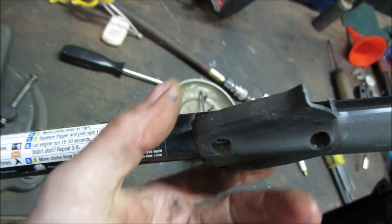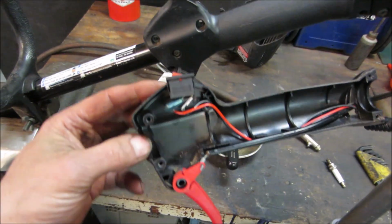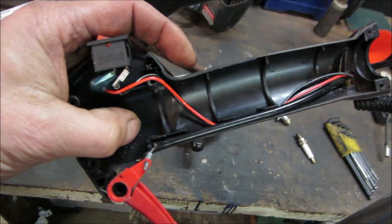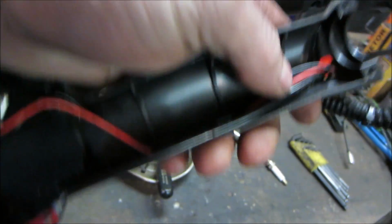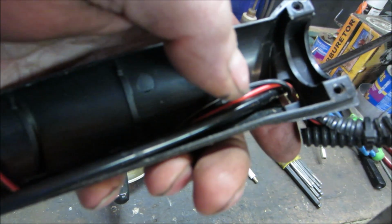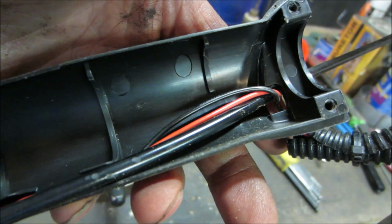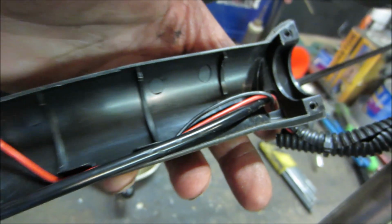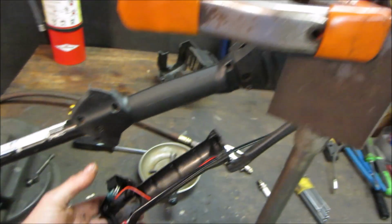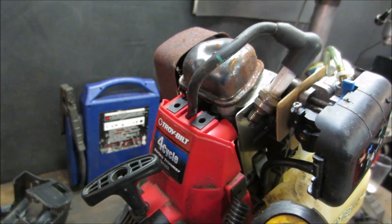If it was touching on the shaft. I don't see any other breaks in the wire where it was rubbing through, grounding out. What about right there? Right there, it looks a little crushed. See it on the black one anyway? I would think it would be on the red wire though. The other one would be open. I could have just missed it altogether and it had spark to begin with. I don't think so. I thought it was looking pretty much like it didn't.